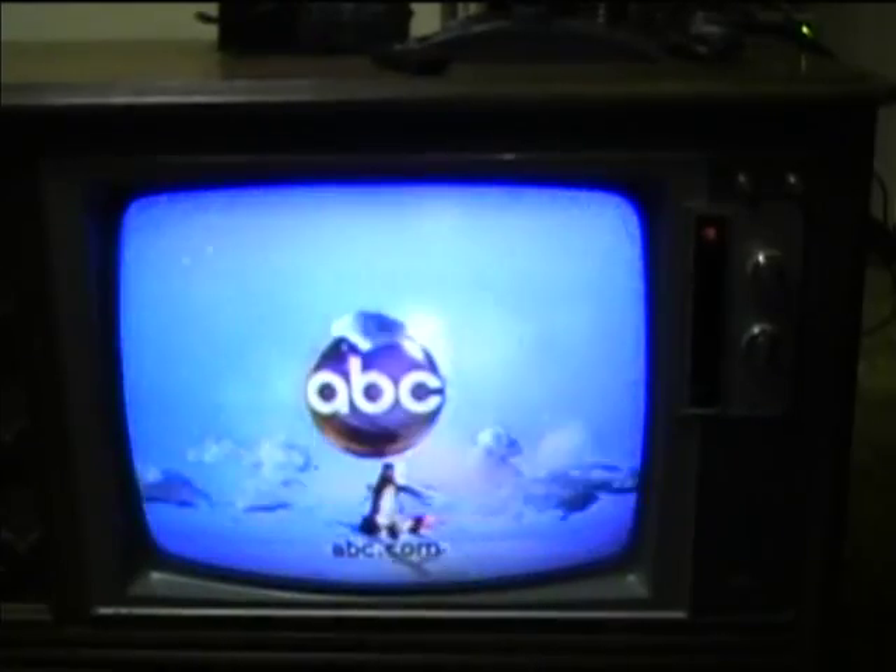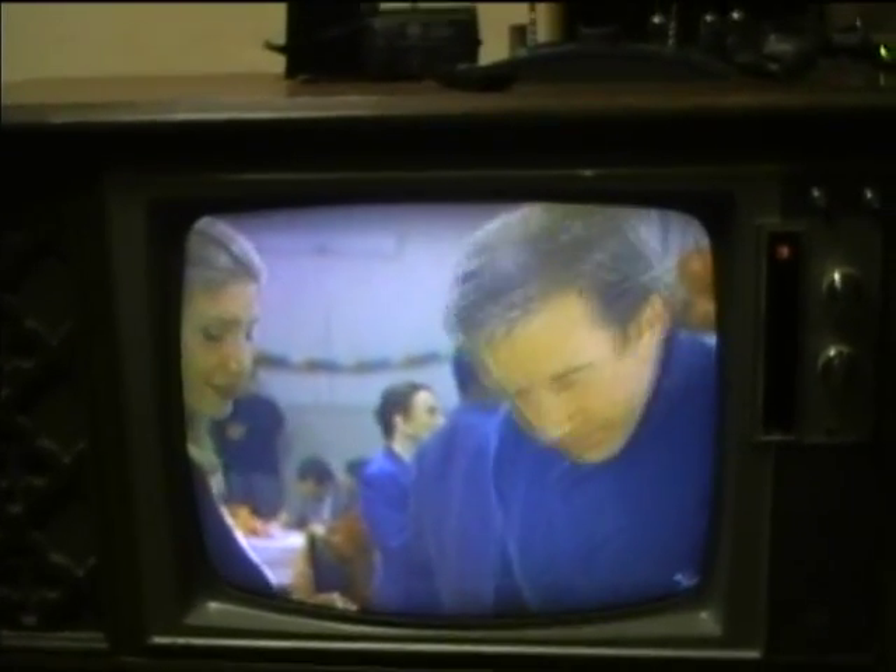I'll put the shield back on, but with those tubes replaced and that coil installed, we now have a really good strong color picture — lots of contrast. Good contrast, good brightness, good color. I'll do a little fine tuning on it. It still could use some convergence setup and just a touch more adjustment on everything, but it really looks so much better. I think I can call this an almost-done job except for a little fine tuning on the convergence.